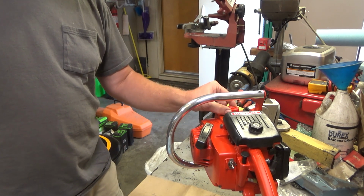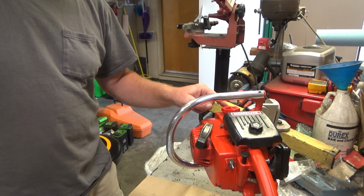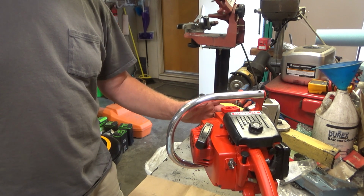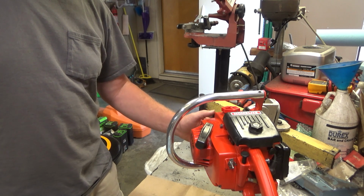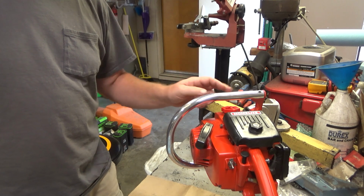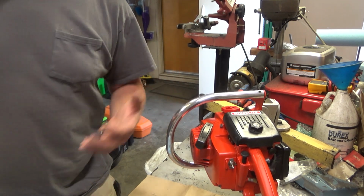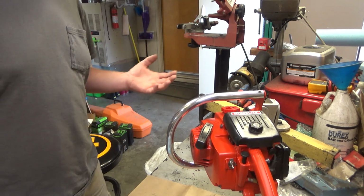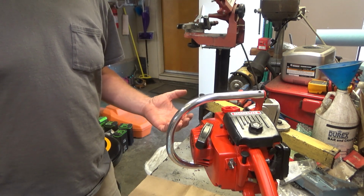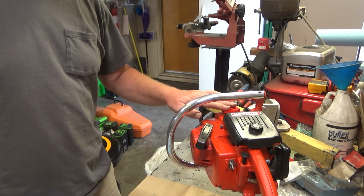And also, when I'm not using them, I like to leave the cap cracked so that it cannot build any pressure. It's only been a few saws that I've had that happen, but I can get a bubble in the seam on the front of the tank. Every once in a while I see that happen, which means that check valve is working really good, but when it builds up pressure on a hot day, like today, it's not super hot here, it's only 91 or 92, but in a hot garage, that could easily be 120, no problem. So anyway, I like to leave the cap cracked.